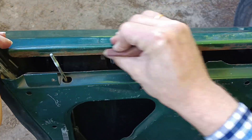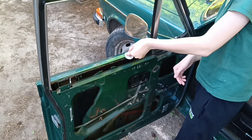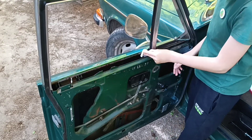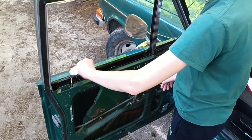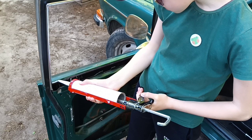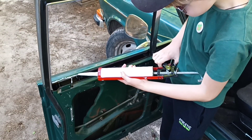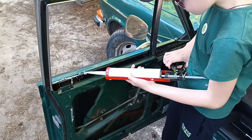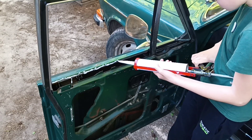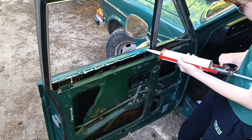This part holds our window seal. Clean it a little — it's a bit rusty — with sandpaper, so the door is ready for installing the new window scraper. Degrease the surface so the odds that it will not stick are minimized. If you work with Volvos, you know they're not so bad as some other cars — good reliable cars available for restoration. We decided to use sealant for fixation and to prevent water penetration inside the door.